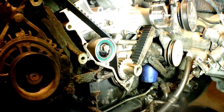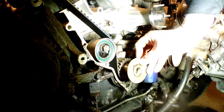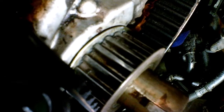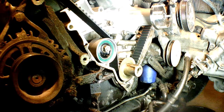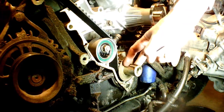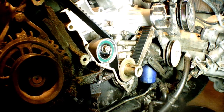I've got the other external plate here — I cleaned off the inside really good, the outside doesn't really matter. As you can see, there's a slight taper on both of those. The back one is facing toward the oil pump and the inside one is facing toward the front of the engine, or the radiator. I still have to clean the cover off before I replace it, but that's where we are. We got that belt on — don't have to worry about anything slipping. That looks like it's about it.